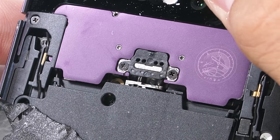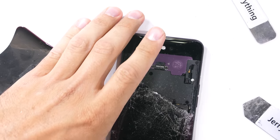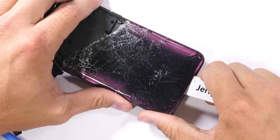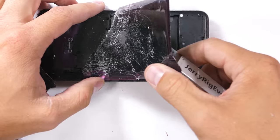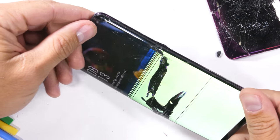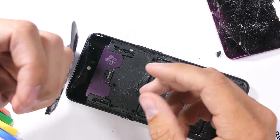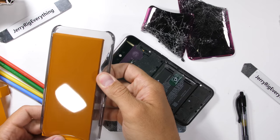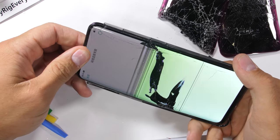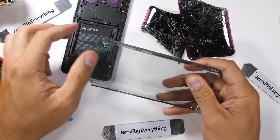I have my doubts — it's putting a lot of trust in something that's wiggly and jiggly. My intention is not to crush Oppo. Innovation like this is pretty much the coolest thing ever, and Oppo is doing a fantastic job of leading the market in the direction it should be headed. The phone looks awesome, but hopefully their next phone is just a bit more durable. Pulling off the rest of the back glass reveals the weak point in the frame — there's not a whole lot of metal keeping things together, and pretty much nothing structural between the battery and the motherboard, similar to the Nexus 6P. Oppo does include a case in the box, so slap that on as soon as possible. In the mathematical quest for the perfect durable smartphone, the Find X is the equivalent of texting your ex — just don't.